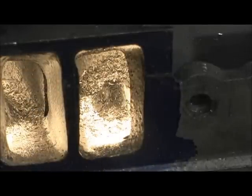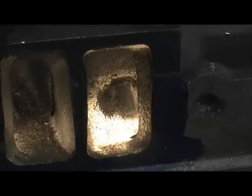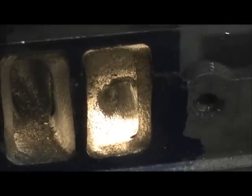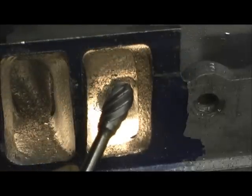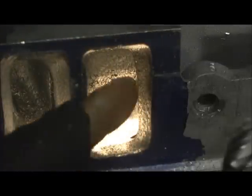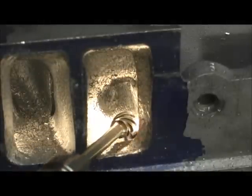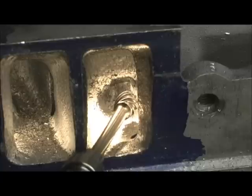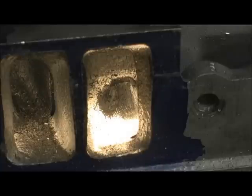All that's doing is just basically trying to level out the little humps and blends. Remember, the smaller the burr and the more closely together the paddles are, the less material it will take out — therefore it won't dig and leave marks in it. Then there's the finger cutter to clean it up further. Right here is where it could bust through, and I'm not surprised at all. There's a valley in there right above the spring perch, and I'm more than prepared to put some epoxy on it. That's okay — it's a non-pressurized area.